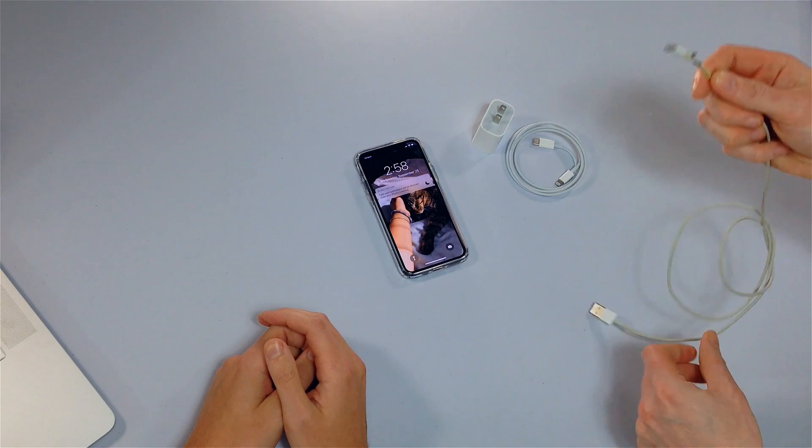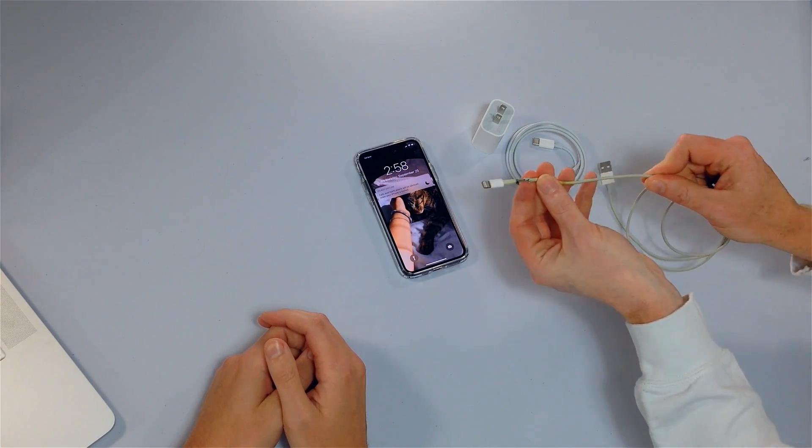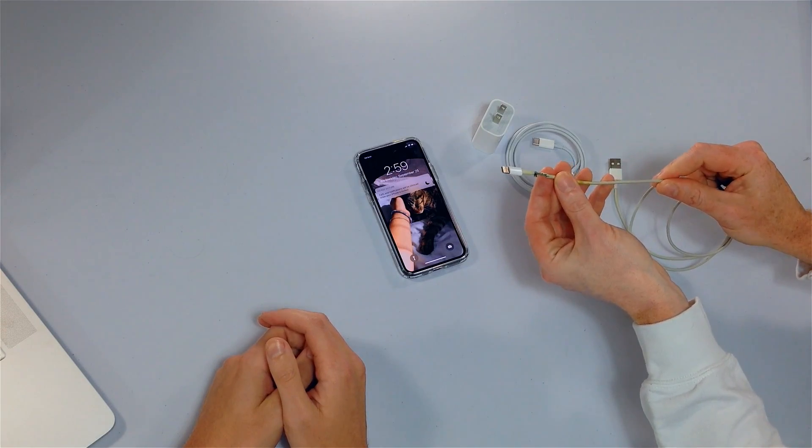Step two is to check your lightning cable for damage. The iPhone 11 Pro and the 11 all come with the USB-C to lightning cable. This is a brand new cable — no damage here. But this is a frayed lightning cable, not unlike the ones we would see all the time at the Apple Store. Check both ends of your lightning cable for damage and try a different cable. Also make sure you try a different charger too — it's possible your charger is what's causing the problem, not your iPhone. You can use any of the older chargers or cables with the iPhone 11. Just try one of the old ones, try a friend's, try plugging it into a different outlet.